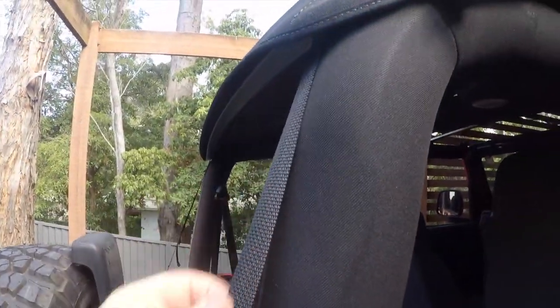I've tensioned the back down and lifted up the Sunrider section until these straps — which I have to thread down between the speaker pod and the roll bar — are accessible. I've undone these, positioned the strap around the bar, and that should give me my centre of the roof line where the top has to sit.